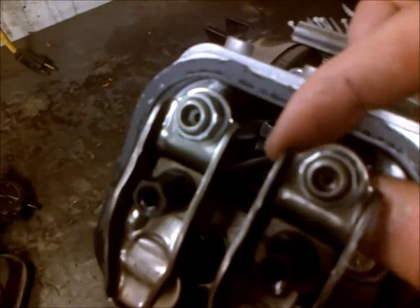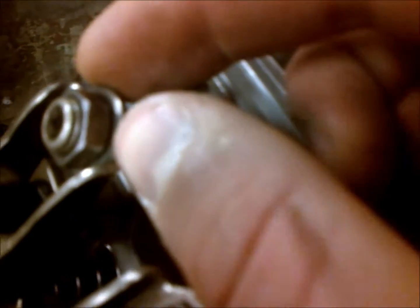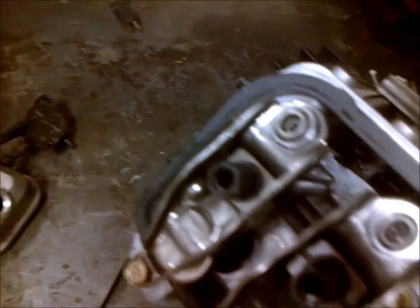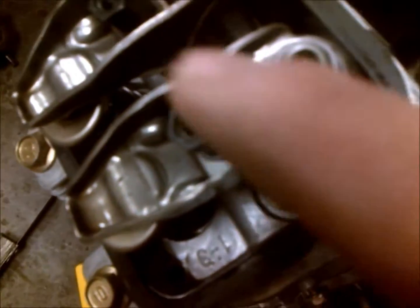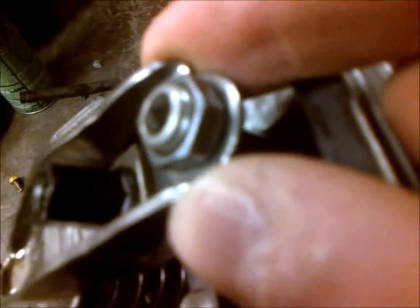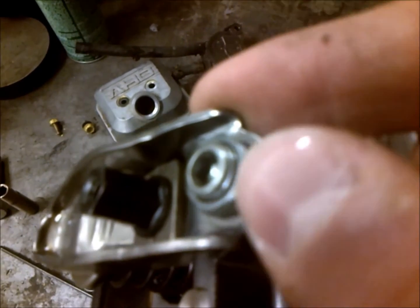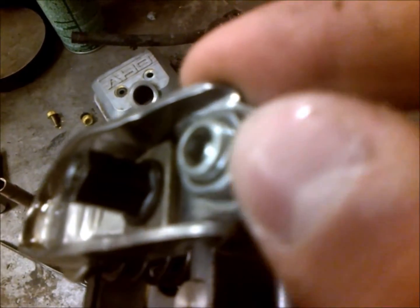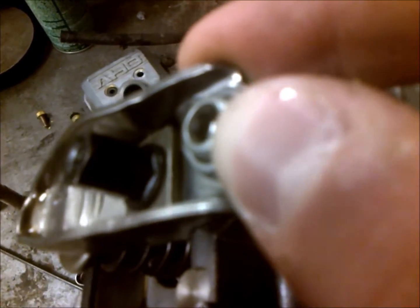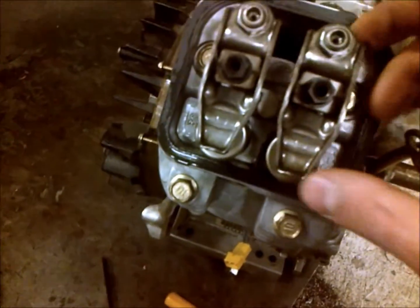Or your rockers rather. Most of them have a locker on them. When you use solid lifters, most people don't just use a simple nut like on cars. On this Briggs it's a pivoting rocker arm where the adjustment is actually on the back of the rocker arm. Usually you have two methods of adjustment — an actual adjustment, and then a nut or locker that locks it in, like you see mostly on cars.